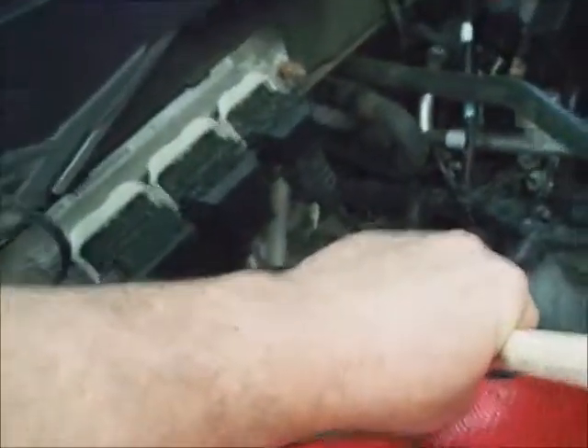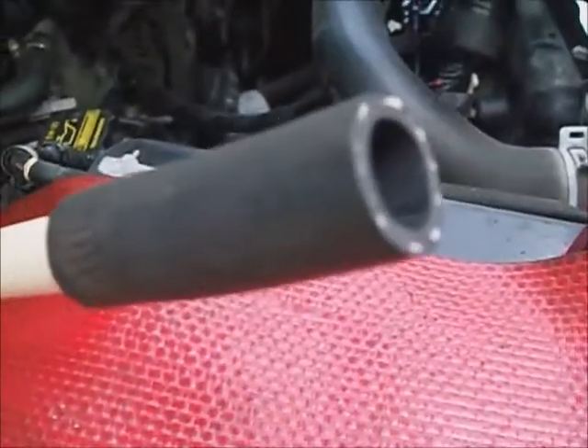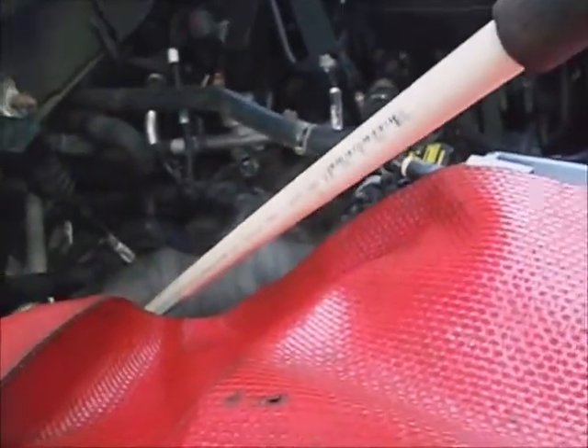There might not be enough room for the hose to avoid getting burned up on the exhaust when it's running. The other end comes up on top, so I can keep it off the exhaust and just lift it in and out to check the level. I cut a 2 and a half to 3-inch piece off of that 5/8-inch heater hose to use as a funnel adapter. I'll put 4 quarts in initially.